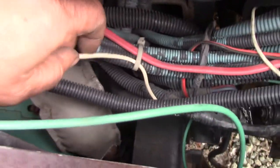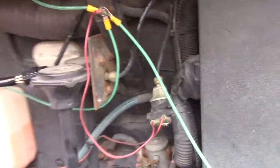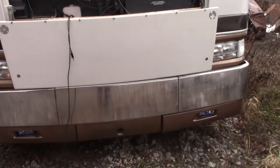This white wire is also a ground — it comes up and grounds this relay. The whole bulkhead here, the front of the bus underneath the hood, is a piece of plywood. None of that's grounded unless you run a ground wire to it. Up here it hooks into fiberglass — and fiberglass doesn't conduct electricity. So this was driving me nuts for a while. I checked the switch, I've been checking everything.